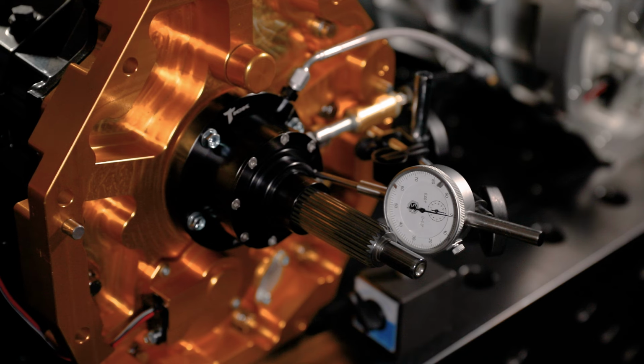So I'm going to just push this down and you're going to see how this works. It's pretty simple. This would simulate clutch in. Currently that's 450 thousandths of travel, so that means it's moved 450 from base to full. And this kind of highlights what I'm saying when I say that thing's going to move as much as it's told to move. The master cylinder is going to move that thing as far as it can move by the amount of fluid that's displaced.